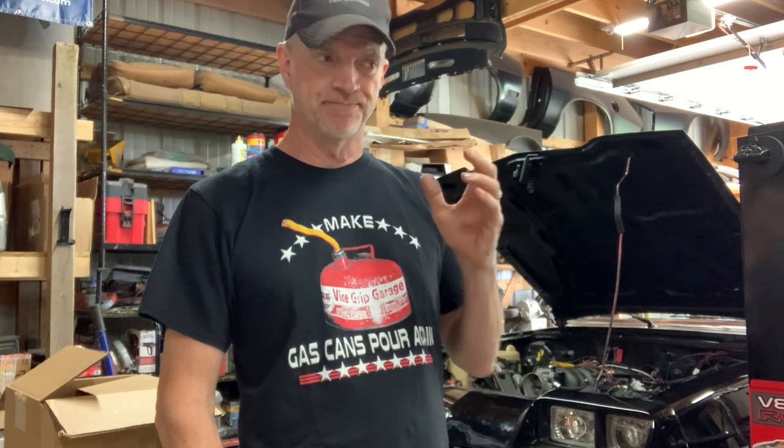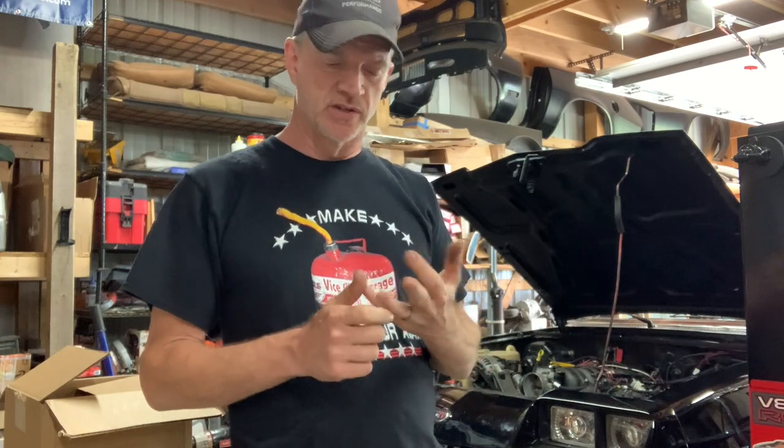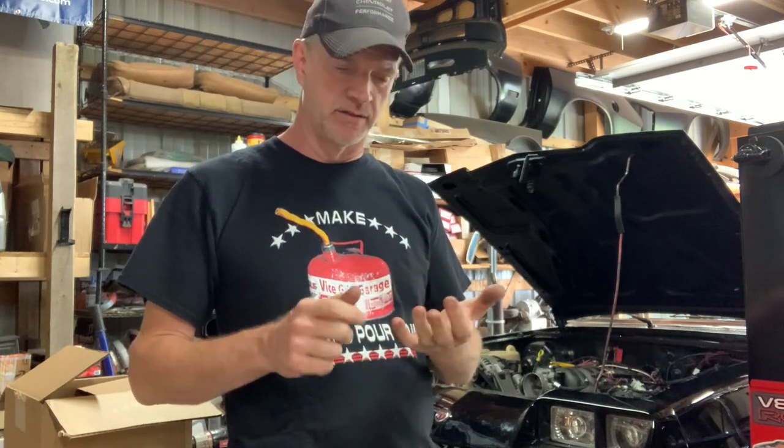Okay, I'm back. A lot's gone on this morning. Let me try to quickly explain what we figured out and what our course of action is going to be. I have been on the phone with everyone I know this morning, first thing since I woke up. I'll just cut to the chase. I was able to download the Holley Terminator software onto our laptop. And you don't need the dongle, because there's an SD card in the side of the handheld that you can pull out and put in your laptop.